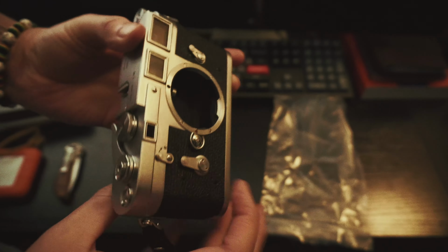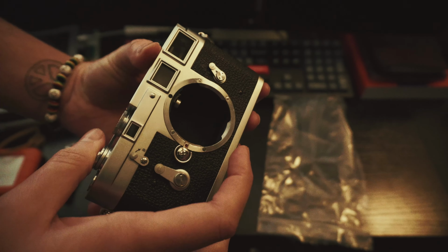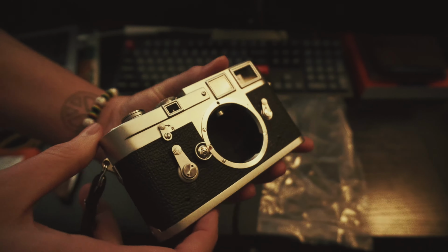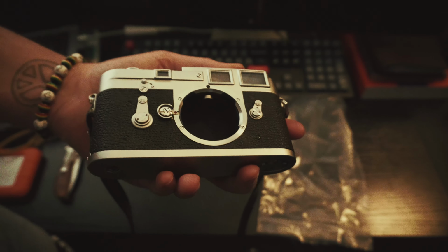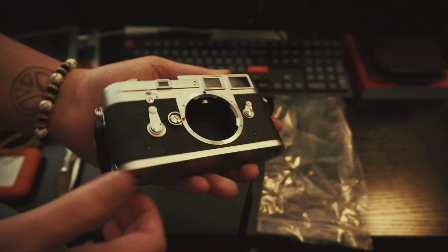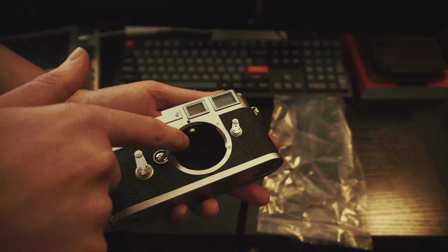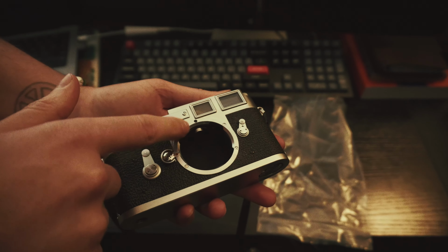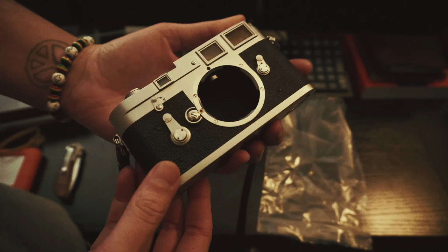But yeah, I was getting a light leak, and so he basically replaces the old shields with a newer style shield, which I'm assuming is a shield system that's in the M6 reissue or the MPs, MAs. It's actually a black plastic piece on the inside, between the shutter curtain housing and the baffle. And so he actually does a test with a roll of film.